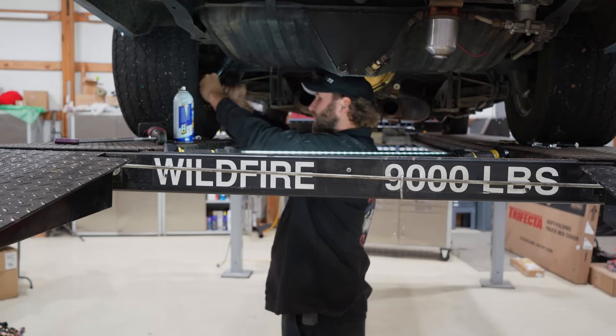Okay, so one thing, I forgot to hook the vacuum advance up. It's probably one of the reasons our curve is so flat. Also, we're gonna play with the timing. It was at 32 degrees, which really isn't that much for a small block Chevy. I ran up to 37, 38 before. But we pulled 2 degrees out, and we're gonna run it again, just for a sanity check. If we do see it go down, then we'll maybe go to like 34 or 35, and a little more rpm, and see what it makes then, but we're making progress.